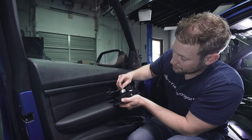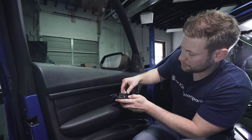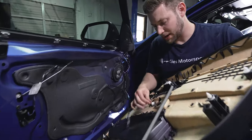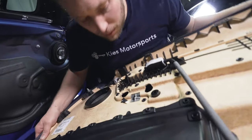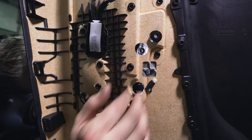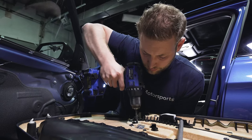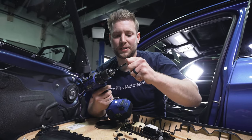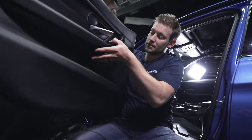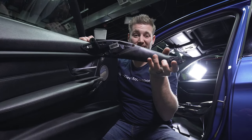For what we're doing, we need to remove it. Press on this little tab and gently rock this little lever down — that'll pull that out and then we can remove the door panel fully. Pull this wire out of here. When we look in here, we can see the plastic rivets that we need to drill out — there's one right there and one right there. Drill them out just like we did on the other side, and a lot of times it'll just pop off and stick to your drill bit. Once you've done that, the handle will come off pretty easily — just pop it off, and as you can see this one is gross too.